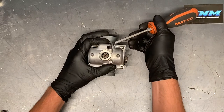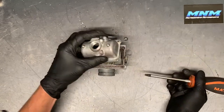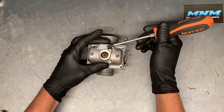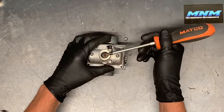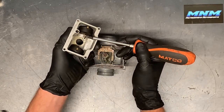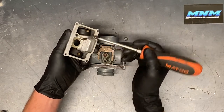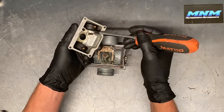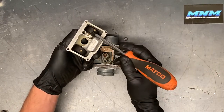There's an overflow tab here — this bottom nipple should have a vent line going to it, and you want that to drain underneath your four-wheeler. If your four-wheeler is bouncing around in the back of a trailer or pickup, that fuel coming out of the overflow will dump directly onto your cases. So make sure the vent line runs underneath the vehicle. The overflow port is here — fuel sloshing around in the bowl is going to overflow into this overflow tube and drain out the bottom. Make sure you blow through that with compressed air so it stays free and clear.